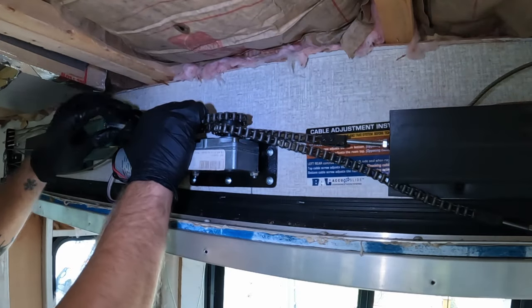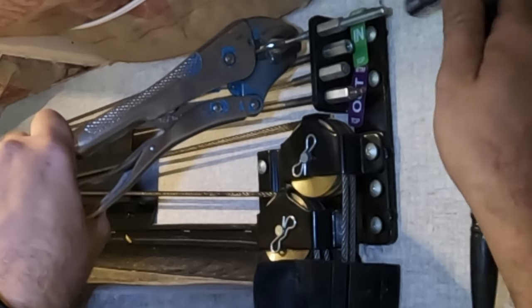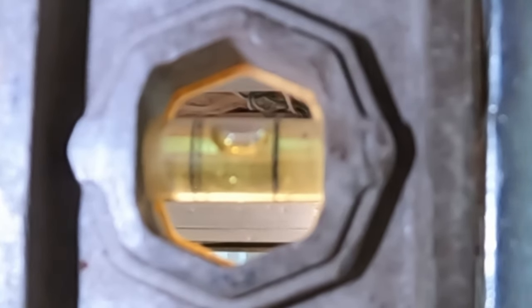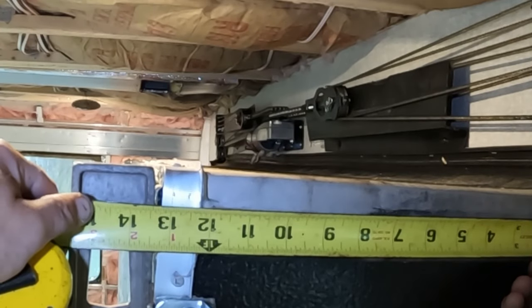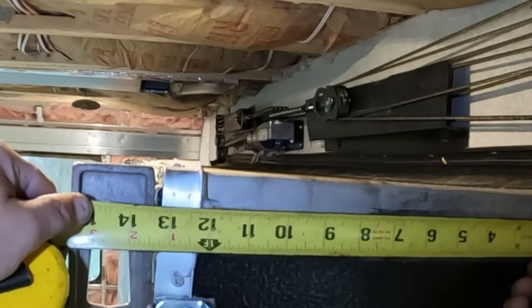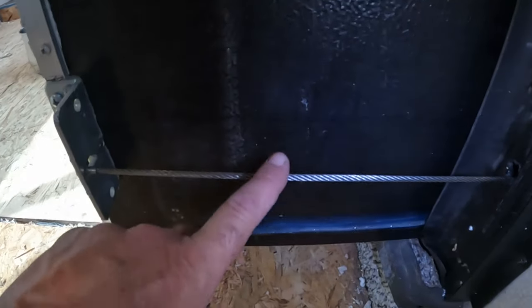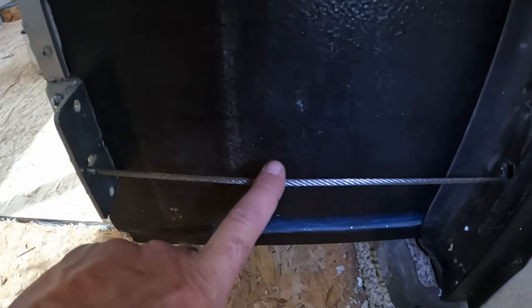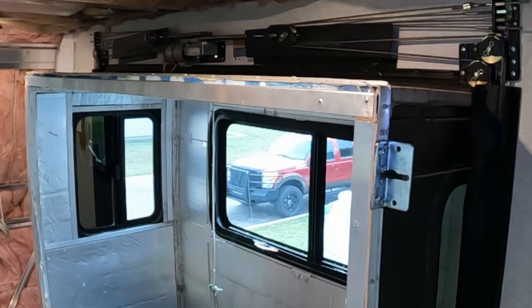Reattach your chains and the pulleys at the ends of the chains. Start with your slide room mount so the drive chain pulleys are next to each other. Tape a level to the front of your slide, then locate the adjustments for the cables. Hold one side of the cable with a pair of vise grips so it doesn't spin while you're trying to adjust it. Tighten or loosen the set nuts as needed to adjust your bubble level so the bubble is centered between the two black lines. Measure the distance from the wall to the end of your slide in all four corners and repeat the process on the other side. Take measurements until your slide room is square and equal distance from the wall, then check the tension on each cable — if one is tighter than the rest, adjust it back out and repeat as needed to make sure your slide room rolls nice and smoothly in and out.